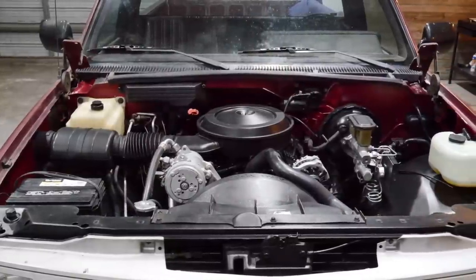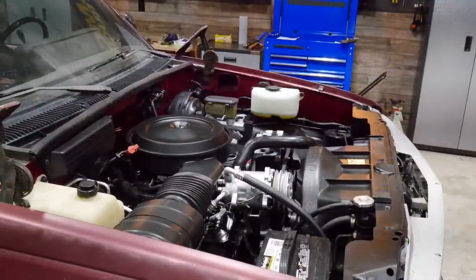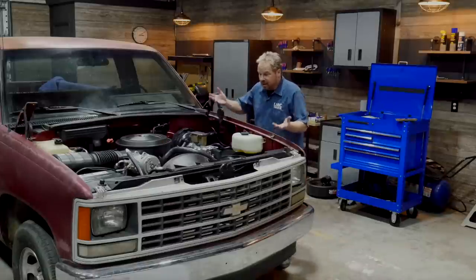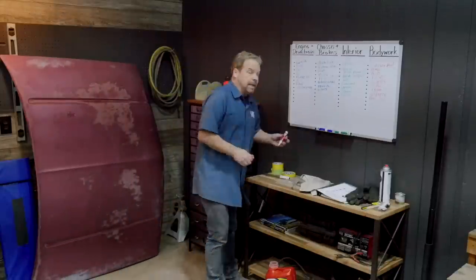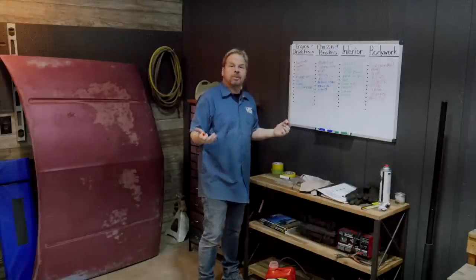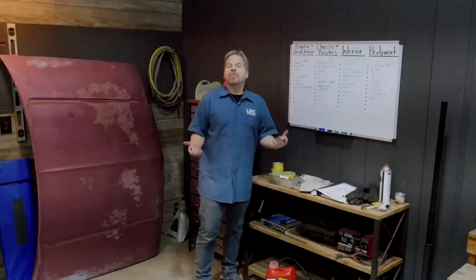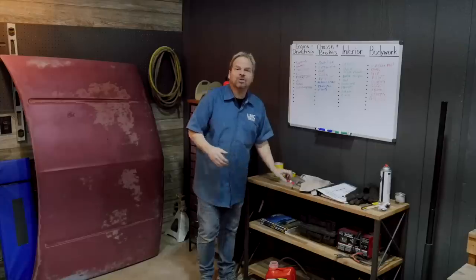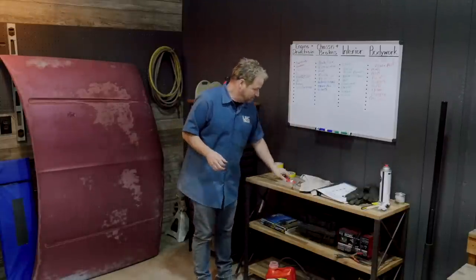With everything reassembled, it's remarkable what a little cleanup, a few new parts, and some paint can do. All told we spent a few days restoring under the hood, but it's not lipstick on a pig — it gave me the chance to really get down and inspect everything. I'm really happy with this. It's all freshened up and looks like a brand new truck under the hood. On top of that, we replaced leaky valve cover gaskets, changed the oil, put on chrome valve covers, painted everything, replaced plugs and ignition wires, installed a new oil filter and high mileage oil to set it up for another 100,000 miles of driving, and flushed the radiator. We've got it absolutely buttoned down under the hood. Now we can work our way towards the rest of the drivetrain — one bite at a time.